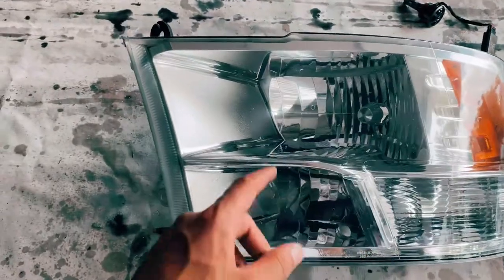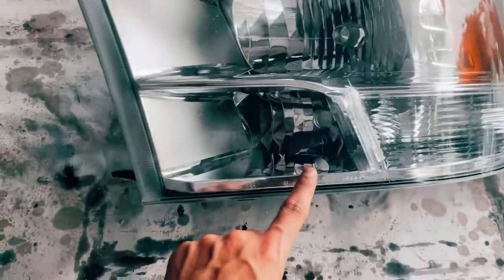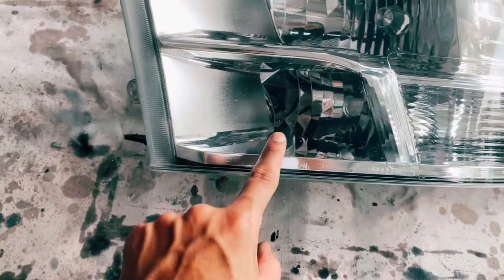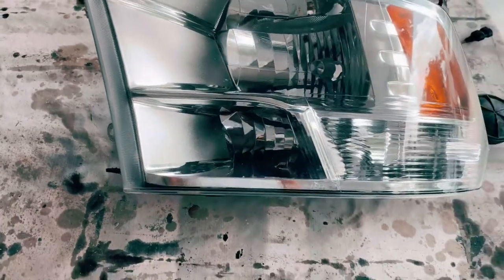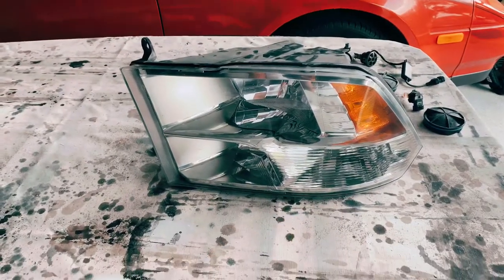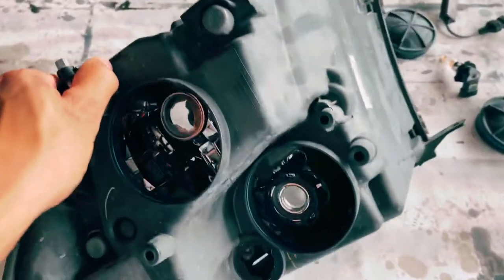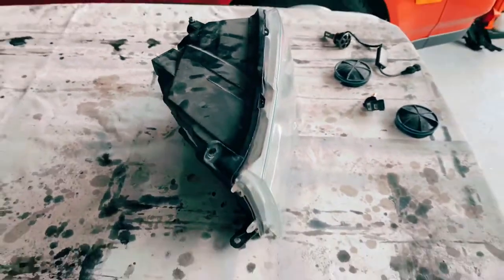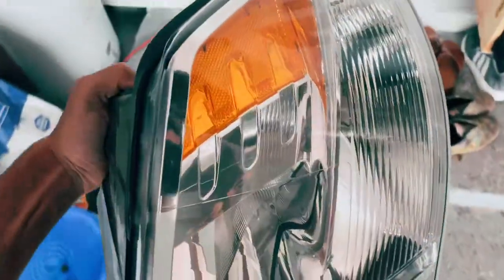Got the headlight out. This is where my main LED is — I have room for another light here. I've seen people put light pods in here and it looks decent, but I can add that later. For now I'm just focusing on paint. Now you're ready to stick it in the oven. Just make sure all your light bulbs, plugs, and anything else that might melt is removed. We're going to bake it at 225 degrees for 12 minutes.